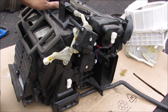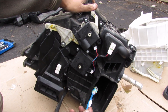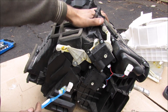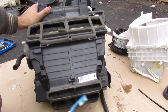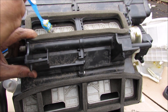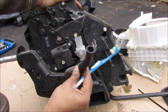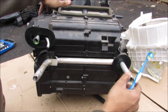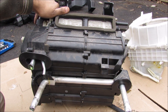Taking a 360-degree tour of the mixer: we have the air inlet that collects air from the blower motor, two actuators with their respective actuating assemblies, a connector at the bottom for a temperature sensor. At the front we have the foot vent, the face vent, and at the top the defrost vent. Along the side we have a vent tube from the internal temperature sensor to read the cabin temperature. There's another actuator on this side, and at the back we have the two coolant lines that go to the heater core and the two air conditioner lines that go to the evaporator.